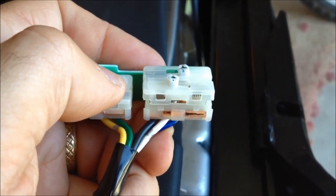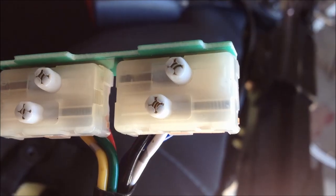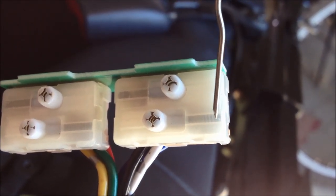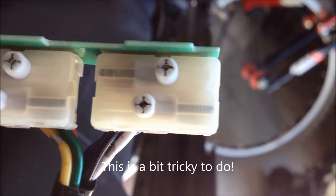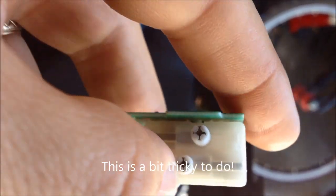There's the cover in place ready to snap down — the ball bearings are lined up under the springs. One of the issues I had reassembling this is that the spring has to be tucked in. I kind of lined it up, pressed the switch together, and then had to literally lift up this tab. I used my paper clip to poke the spring into position and get it beyond the lower half of the switch. It's hard to explain, but once they're lined up you're good to go — give it a test and it should function properly.